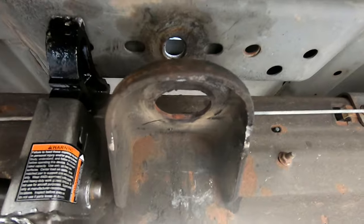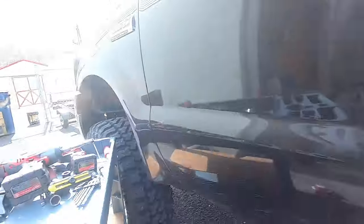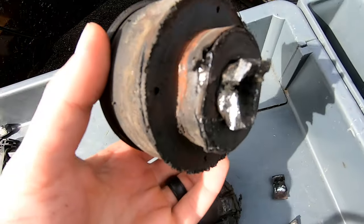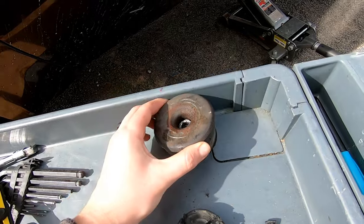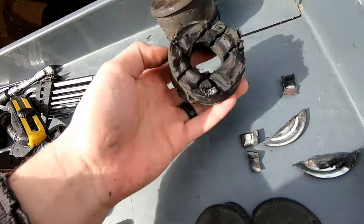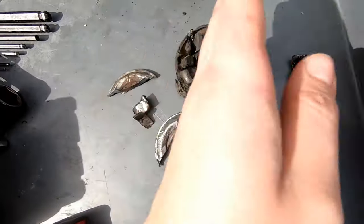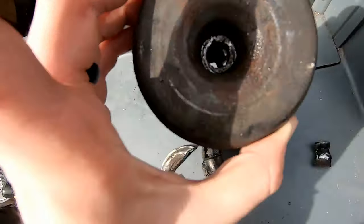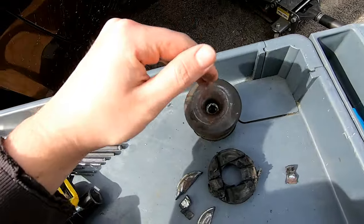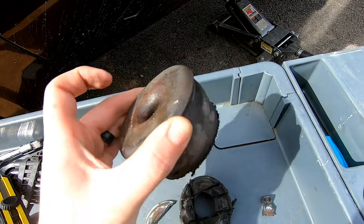This one right here in the middle — the third one from the front — on my 2006 F250, mine was seized in there. It actually has a metal sleeve that goes up to the middle. The sleeve in the middle was seized and I had to cut it out — I had to make four slits in a hashtag pattern and then I could lift it up. I tried soaking it in PB Blaster and beating on it from the top from inside the cab, but I could not get that metal sleeve to come out.